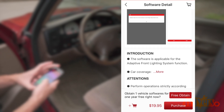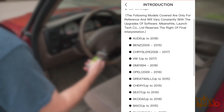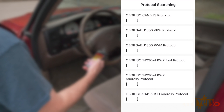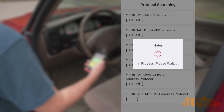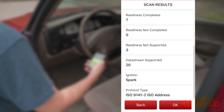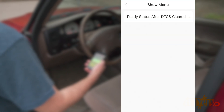If you download or purchase additional maintenance softwares, you'll see a description of the add-on along with an application list for each one. OBD Functions is where you strictly scan a vehicle's check engine light — a simpler version of the all systems diagnostics. Under this option you can scan or clear codes, check system readiness, view descriptions of codes, view live data, freeze frame data, check if your vehicle is set up for emissions testing, and view module information.